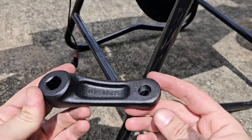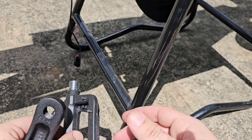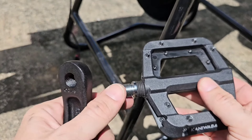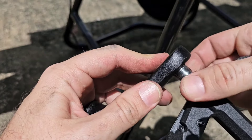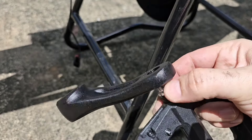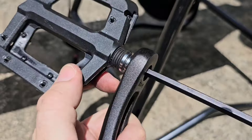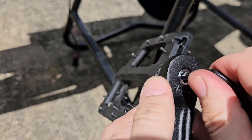Now install the right side pedal and crank. Check it says 'Right' on the crank. Take the right pedal — it should say 'R' on it. Take the right pedal and right crank and start threading it by hand; that ensures you don't cross-thread. Once it's in the correct position, use the Allen key to tighten it properly. Put the crank on the spindle and use the screw with an 8mm wrench to tighten it very well.